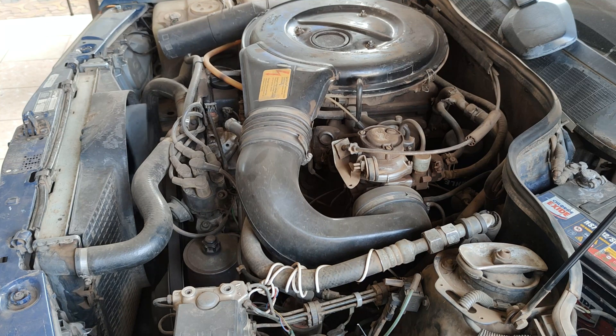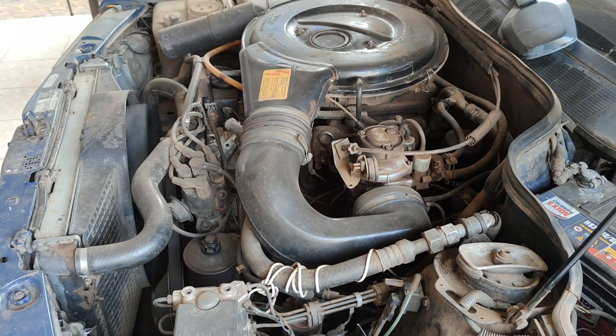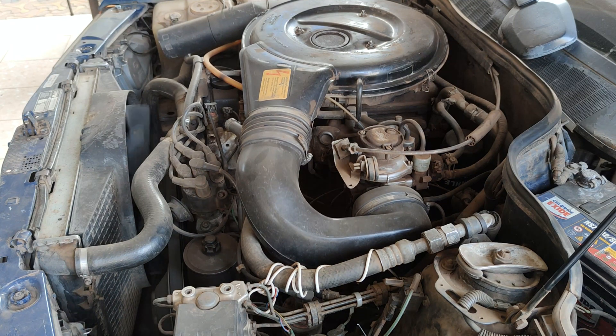Again, as mentioned earlier, as the engine is warming up the fan should be free to move and you should be able to stop it with your hand. So if yours is not viscous coupled but is a magnetic clutch that is on throughout, then see a mechanic who can sort your problem out.